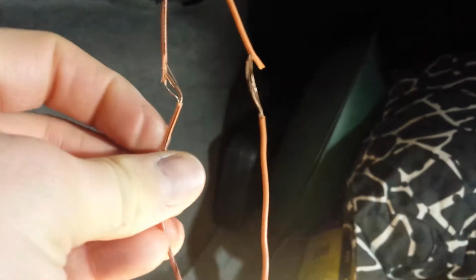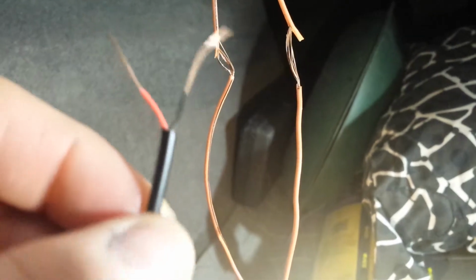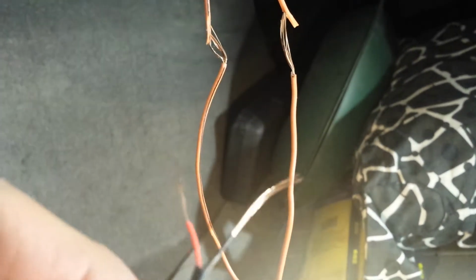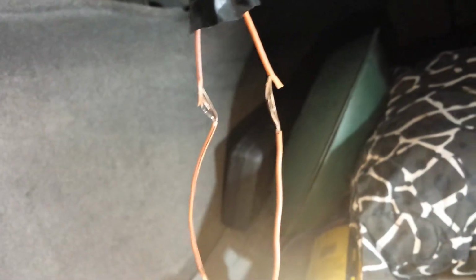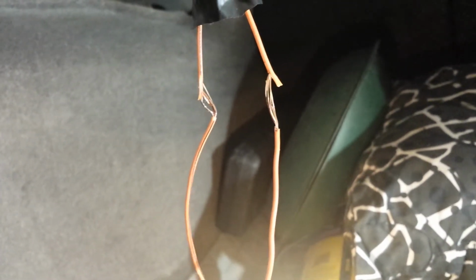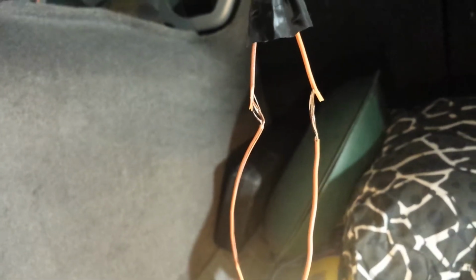You can kind of wedge it apart, and equally as possible, you stick that, twist it up a little bit, stick it through, wrap it around, and then electrical tape the end. You have a super secure connection where you don't have to worry about soldering, but at the same time the clips sometimes could pull out or destroy the factory wiring. Once you do that, it's secured on there, tape it up so you don't cross the wires, and you got a pretty good connection. I'm going to do that, connect my light now, and we'll come back in a sec.